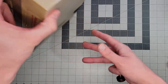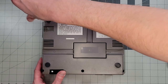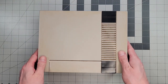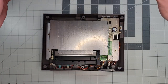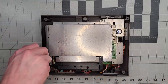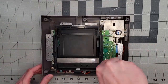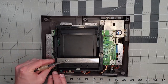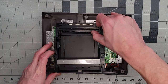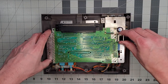Compared to some of the other repairs on this channel, the NES is super easy to work on. To get started, we just need to remove the six Phillips screws around the perimeter. Flip it over, and the top shell comes right off. Now we'll take this shield off by removing these seven screws. And then the game slot, which is held in place by these six screws. There's one more screw to get up here, and now we can remove the board.